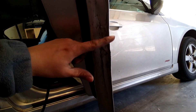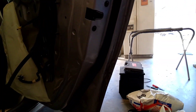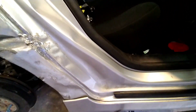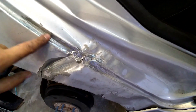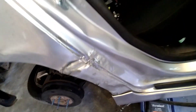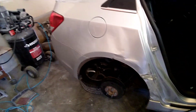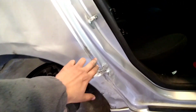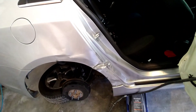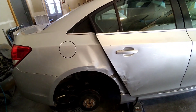We still got a little bit more work to do right there, but that's where the head impact was. We're getting it done. Over here it still looks kind of rough — we're working on doing this little line right here, following the OEM line before we get to the outer skin. Now that we're done pulling the inside skin, all we've got to do is line everything up, make sure the door is lining up, then finalize it and start pulling all the little ones. The door is almost there.